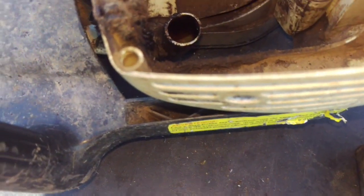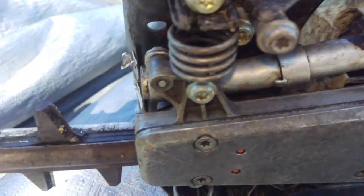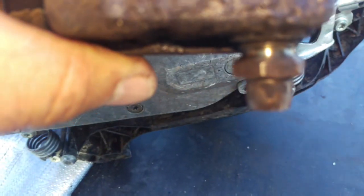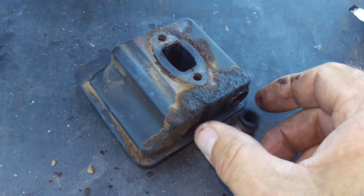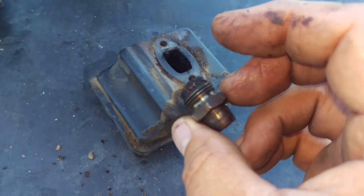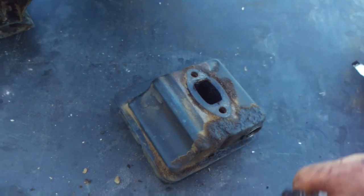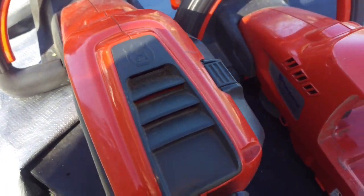When the muffler is in place, there's the little guide tube that comes out the front for the exhaust - it pushes it out front. The spark arrester goes in there. I just used the impact and zipped it off at the 5/8. They'd already taken the screen off, so I'll scrape out all the carbon on the inside, put it back together, and it's time for sharpening.